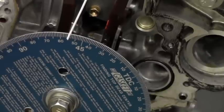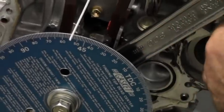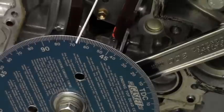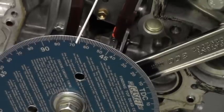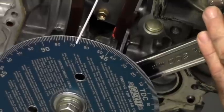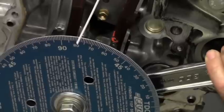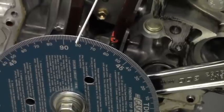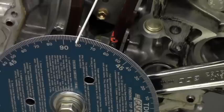One more time — we'll keep going in 50 thousandths increments. Another 50 thousandths right there; your reading is after top dead center, 61 degrees. Now let's rotate another 50 thousandths. Another 50 thousandths then took us to 80 degrees after top dead center.